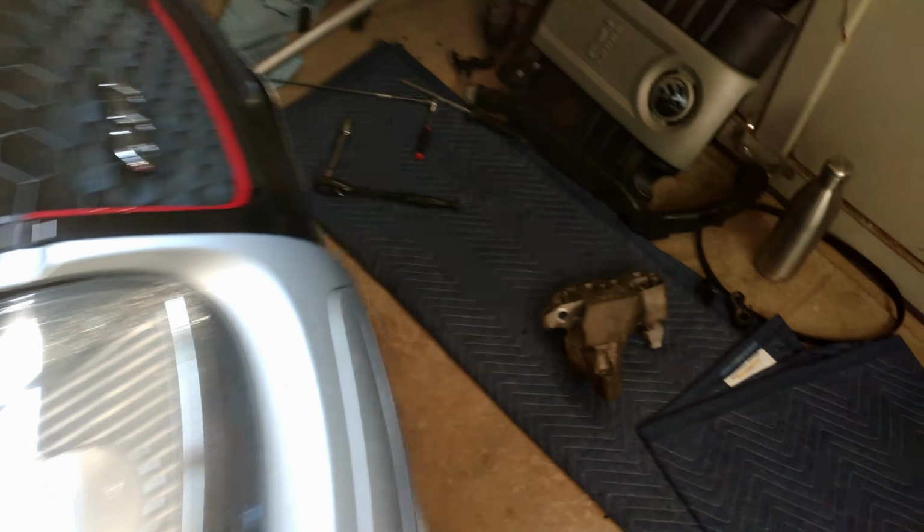So we're replacing the water pump, so that'll resolve that. I actually took a sample of, you see all the stuff pooling up? I took a sample of that. It really looks like gasket material. It doesn't smell like anything though, meaning it could be oil, but you see this little deposit right here? This little piece, it kind of looks like gasket material. So we might have gotten away with it there. But like I said, in the video I placed before, you can see all of the oil up around this side. I think there's something coming up from farther up there and leaking down the side here and then pooling onto the belly pan. So there's something going on, but I don't think it's in the timing belt cover. We might be okay there.